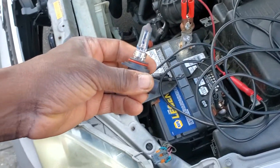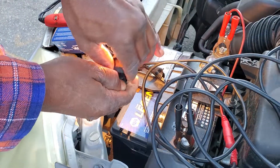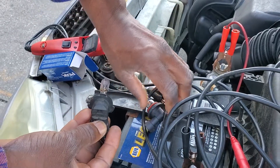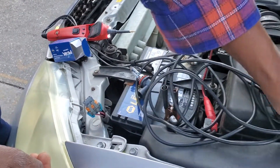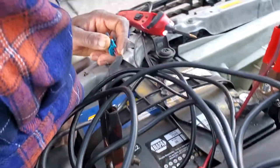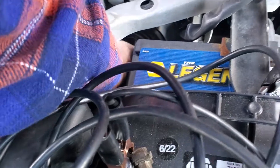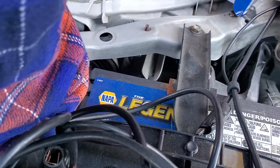I'm gonna hold this new one and try to connect it. Sometimes it may not work, but now it's perfect. If you put the old one in, it doesn't work — no matter what, it's done. So I'm gonna put the new one in. Be careful not to cut your hand; it has a way to put it slowly. Put your hand slowly in there. If you cannot fit your hand, take the battery out and move it. Otherwise it has a space — go with the space slowly, put it in, turn it counterclockwise, then slowly put the light connector inside and push it.